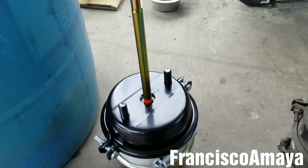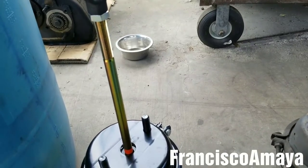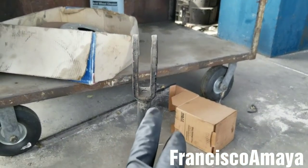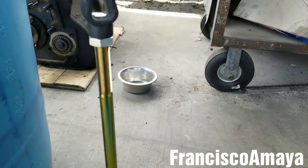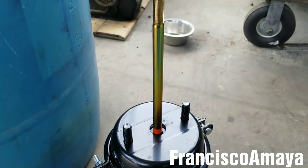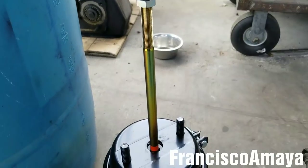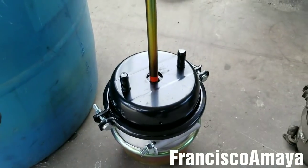This is all about universal brake chamber replacement. If you want to know how to remove the brake chamber, check my other video or the description below. I showed you how to cut the brake chamber pushing rod when using a universal unit. If you have a welded clevis you don't need to do this, but in many cases you won't have the original welded clevis brake chamber. Make sure to follow these details to prevent any problems. Comment below with any questions or suggestions, and check the video description if you'd like to support the channel.